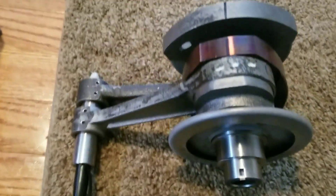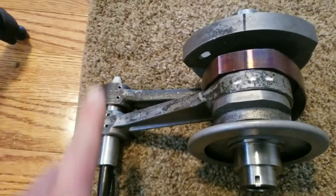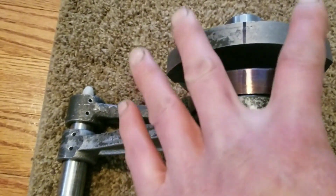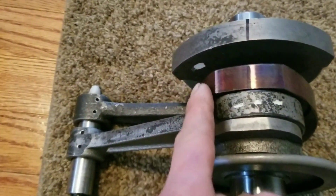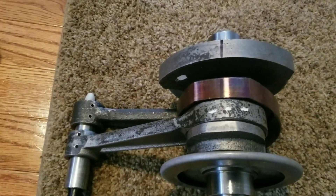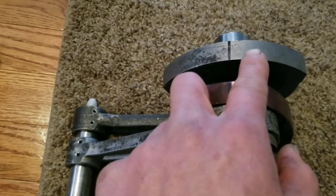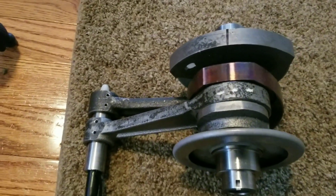Recap: with a good crank, you should be able to slide the pin all the way through, and the cheek and the cheek should line up center to center — measure halfway on each side, they should align. With a hydro-locked crank, the cheek will be upset a couple of degrees to the left or right. It will not line up because it's been forced out of time.